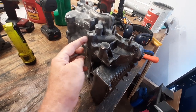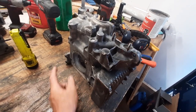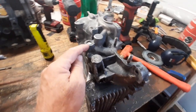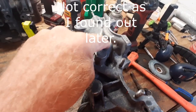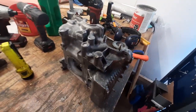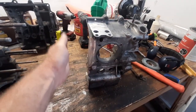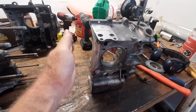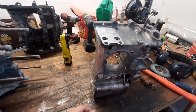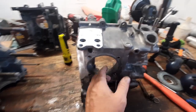Normally the oil flows up through here and then goes through the cooler. When the oil is cold, you don't need it to go through the cooler — you can actually over-pressure the cooler and blow it up. So it pushes that plunger back and lets your oil go, instead of going through the cooler, it follows this path and goes right straight into your main bearings. The secondary relief — this being a dual relief case — had another relief back here at the very tail end of the oiling system. If the pressure got too high in general, it would vent the extra oil back into the case instead of over-pressurizing anything. That's how the dual relief works.